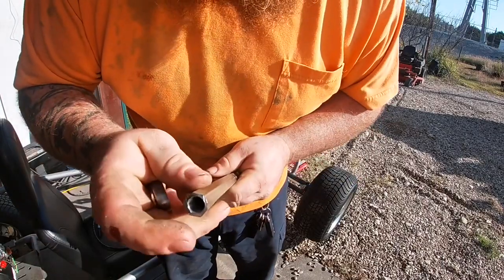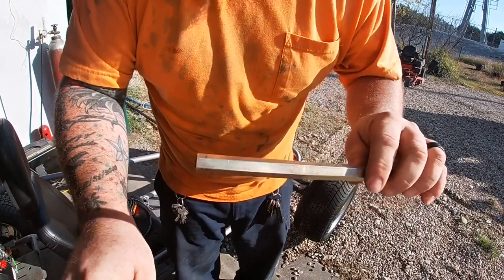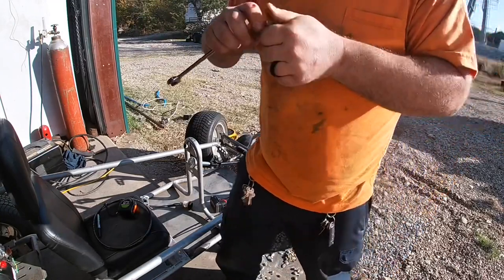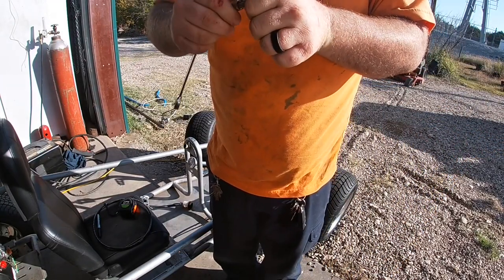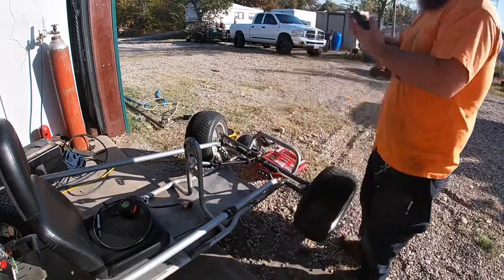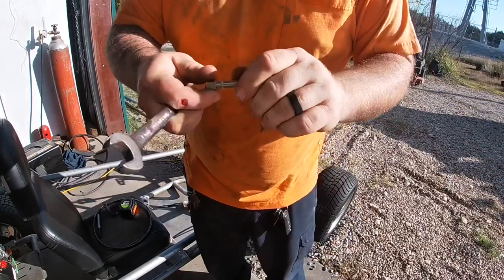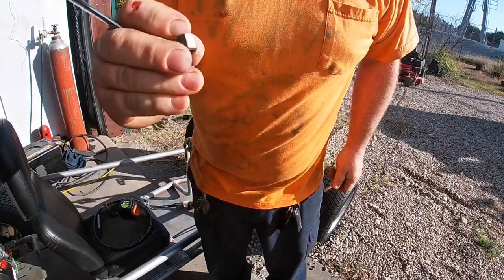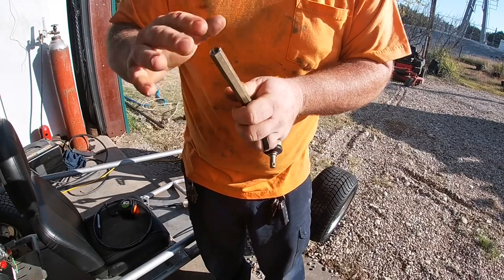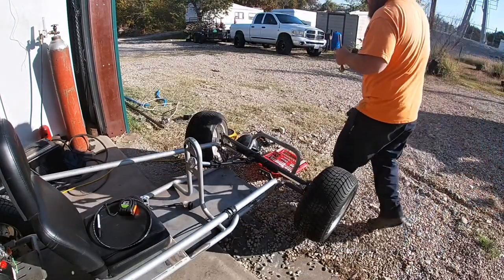And you can see it's got little sharp edges. You can hit it with a flap wheel, but that's 1/2 inch shorter. This will be the one that's fun to get off. There's the other piece. So now, this is a half inch shorter. I'll hit that on the grinding wheel real quick, run my chaser back through it, and it should be good.